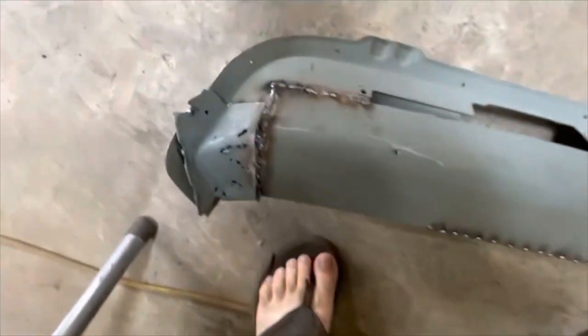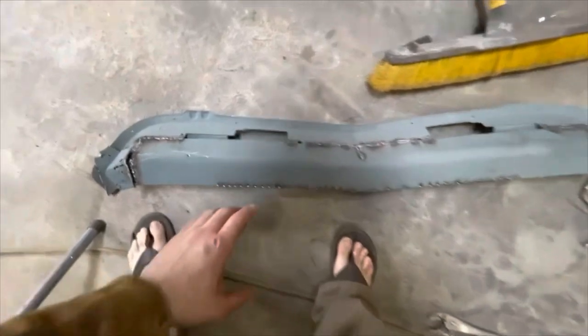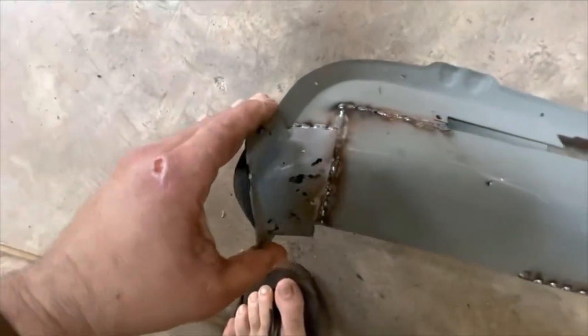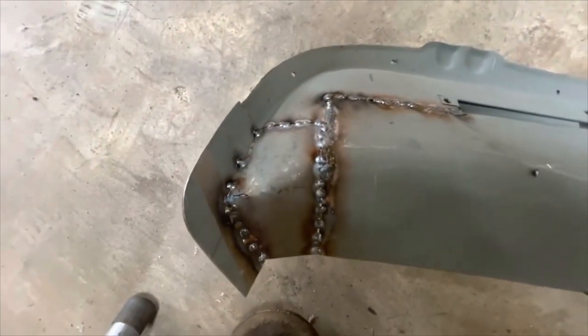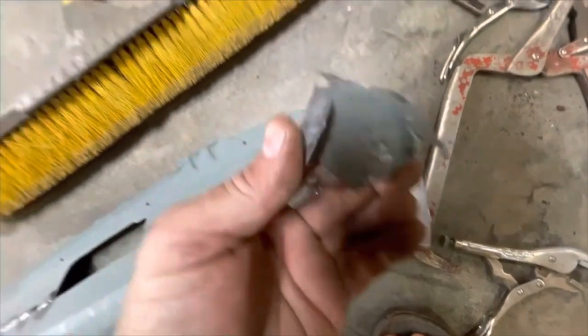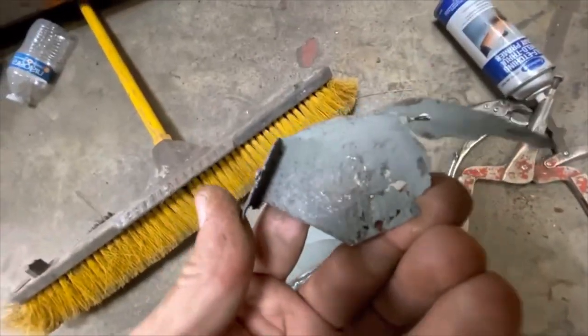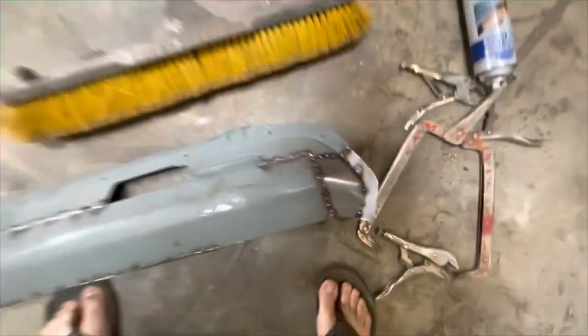Big welding day — you can see I've got my proper welding shoes on. I've been working on these corners of this section. You saw this before — this section sits right above the windshield on the inside of the cab. These corner pieces are totally rotten out, nasty, worthless. Replacing them with ones that I built and turned myself. I created this section first and then created the flange, and I did the exact same thing on this side. Here's the remnant of the totally roached piece — garbage. Making new ones and we're going to fit this thing up.